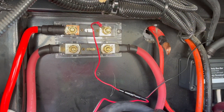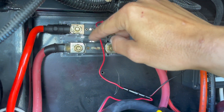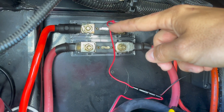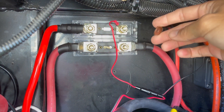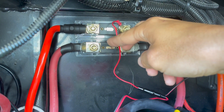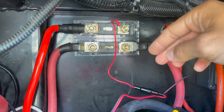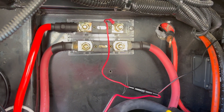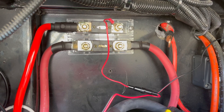Let's get started. The very first thing we need to do is disconnect the electric for our old charger. I already sold the charger, but let me show you what that might look like. Inside my battery bay, I have this wire that comes in off my distribution block up to this fuse, which leads to my DC-DC charger. I've disconnected this wire — the positive is disconnected, the negative is still connected, which is fine. Now let's go ahead and find our new location for the new charger.